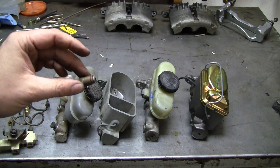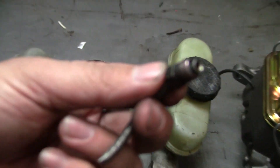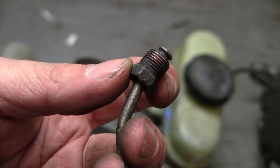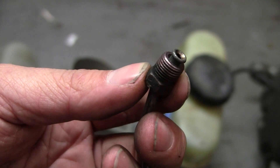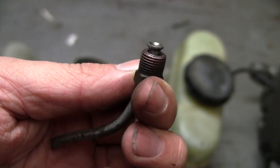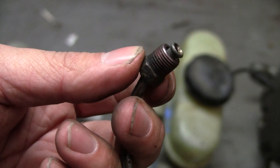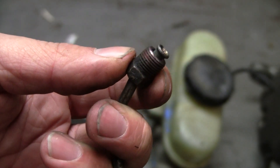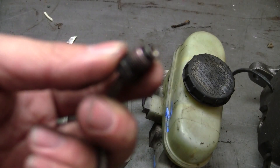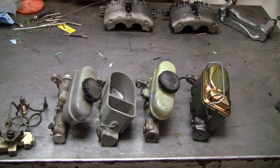There are different sizes of metric threads — I'm just saying metric in general, not talking about a specific size. To contrast that, we've got this one: this is a standard flare nut, so the actual nut has standard threads, and you can see the brake line has what looks like the end of a trumpet — that is a 45-degree inverted flare. This is most commonly used in custom applications and also in older cars; in Mustangs that would be from 79 all the way up to 86. You may also use this flare on a later model car at another part of the hydraulic system, so just because your master cylinder uses metric threads and a bubble flare doesn't mean your whole system does.